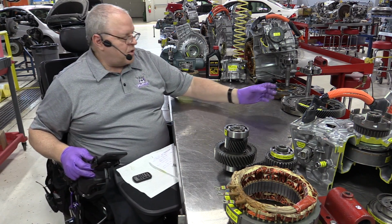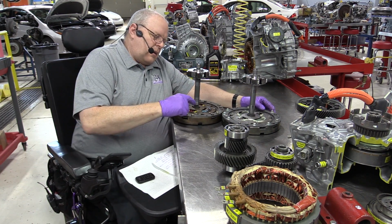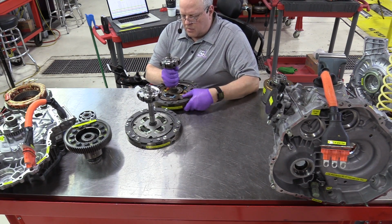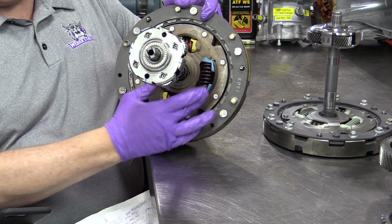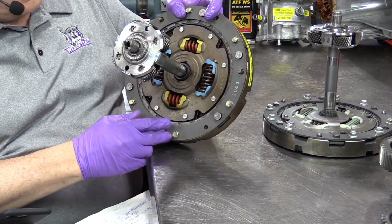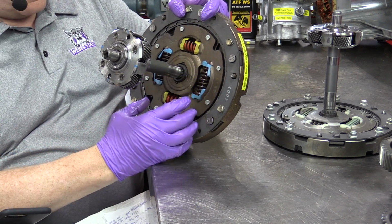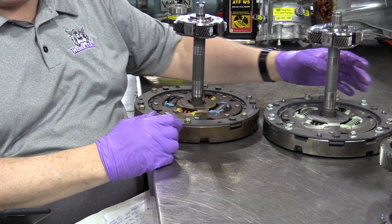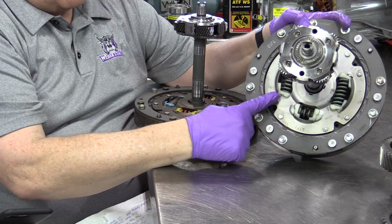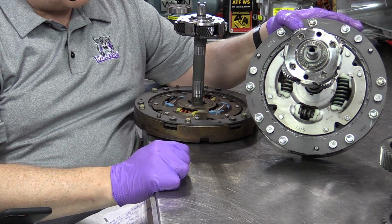All right. Another change that took place was with the flywheels and the clutch damper springs. If you recall, the first generation Prius has a flywheel, a clutch style disc that's permanently applied. We talked about how all that works in the first Transaxle video on the P111. The damper springs here on the first generation Transaxle are extra stiff. And what they tell us in the documentation for the second generation, the P112 Transaxle, is that they made these springs less stiff. As a matter of fact, there's only a single spring in these two side pieces where there's two springs in the first generation Transaxle.